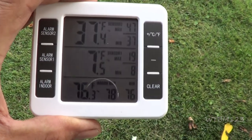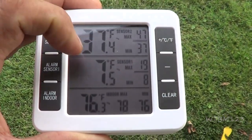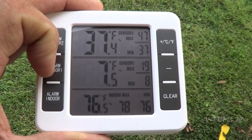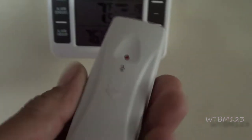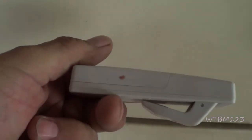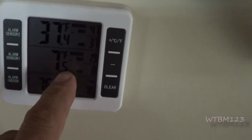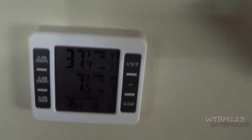You can set a high and a low alarm on these things and it's battery operated. When the electric is out, these are nice because you can monitor the refrigerator and the freezer, and you'll know when you need to start a generator or what the temperature is in there. Notice I had it outside and it still registered the temperatures. You get one of these — another battery-powered thing — and maybe once a year you've got to change the batteries. You just set these in there. This freezer down here is at seven degrees, down in my basement almost directly below us, so this thing picks up pretty good.